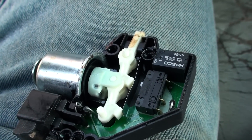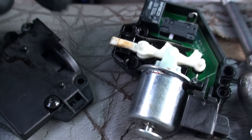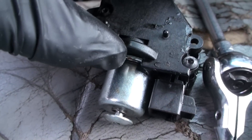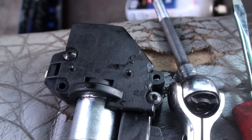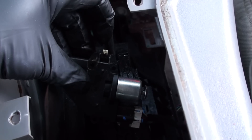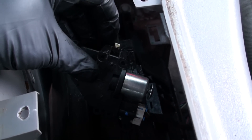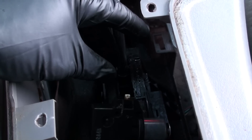It's working pretty good now — nice and smooth. I sprayed a little bit of corrosion X up in here so it's all lubricated, and it's actually working pretty good. We're gonna bolt this back together and then test it while it's off the shift mechanism to make sure it's working. Now that you've plugged the sensor back in and this piece is up right here, it should tell it it's in park so it should actually release your key.